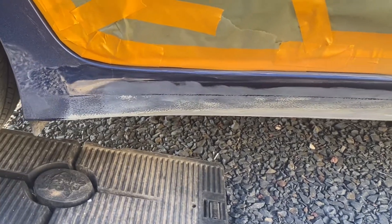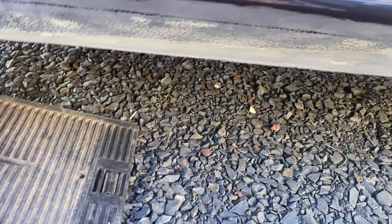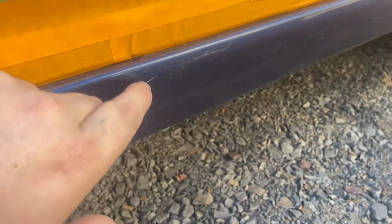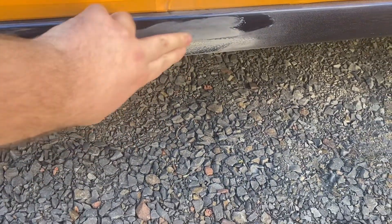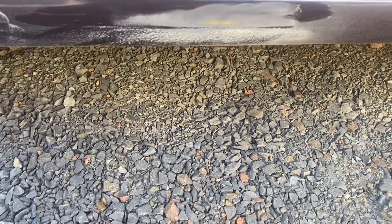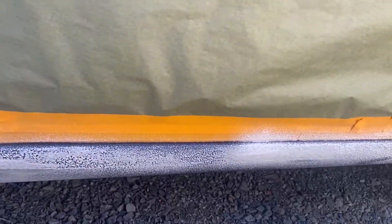I got this all sanded out as far as I want to go. I'm not looking for 100% smooth texture because this whole rocker panel is not smooth — that's just how new cars are from the factory to protect from rock chips and stuff. Now we're just going to get this cleaned up and get ready for the next step. I'm going to address this little tiny scratch. I can feel it with my fingernail so I know it's not going to buff out. So the scratch is gone. Now we're going to clean this up and start prepping it and get ready for primer. For cleaning, I just use a glass cleaner — spray this whole rocker panel down and get it nice and cleaned up.